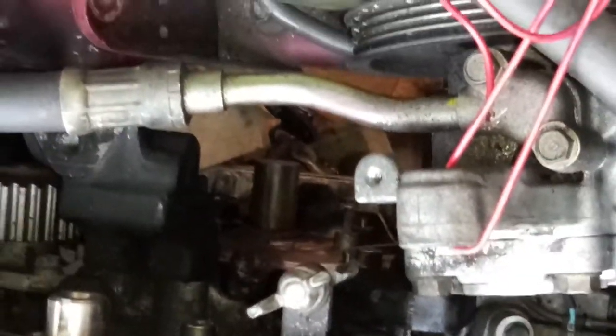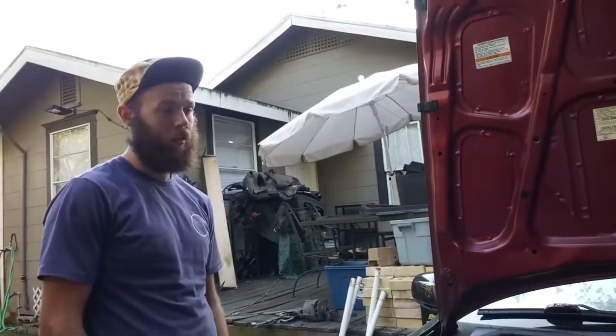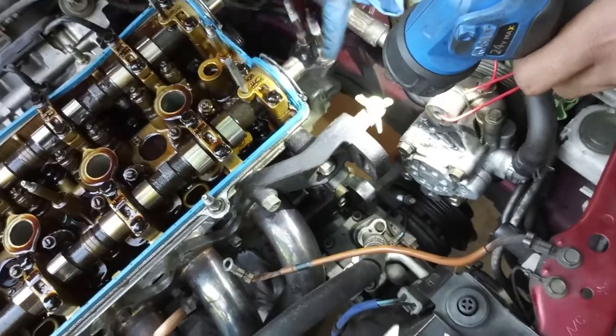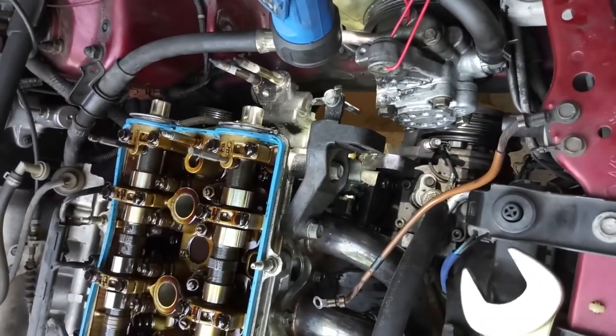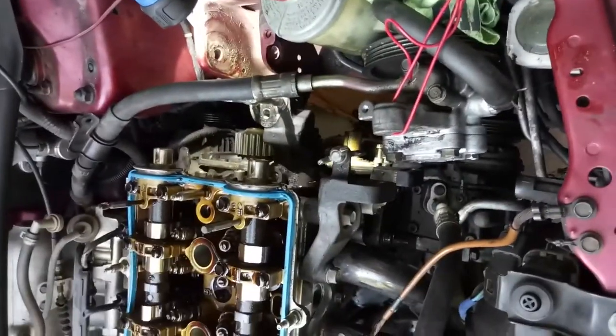Yeah, like the whole way down here. I'm up here and it's covered in oil and dirt. You didn't cut the old timing belt, right? No. I still have it. And even the main crank seal down there just looks gunky. It just looks dirty. It's definitely something going on in there, with a smidge of glisten. Because it did have a little bit of a sheen to it.